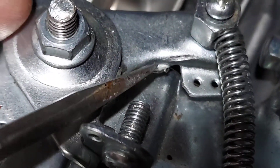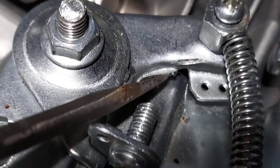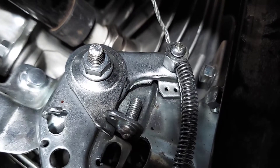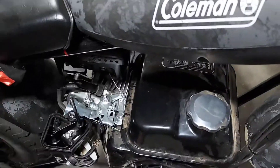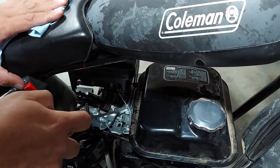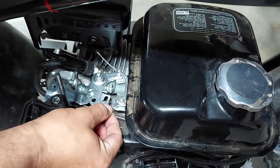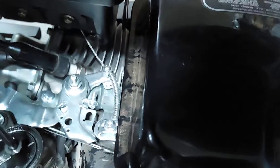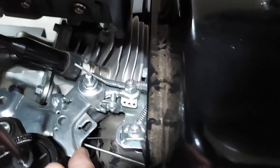Some people say take this and you can bend it, bend it forward. Just get a Dremel and cut the thing off — I think that's the easiest way to do it, because now there is no stopping it. This does make it go faster a little bit. What I've noticed is it does increase the acceleration. It's not just as easy as cutting it though. This spring — what I found after you cut it — is going to want to bind up because the spring is the same length as the old way when it had that tab. So I cut about five links off using some snips, and that lets it go all the way down without binding.